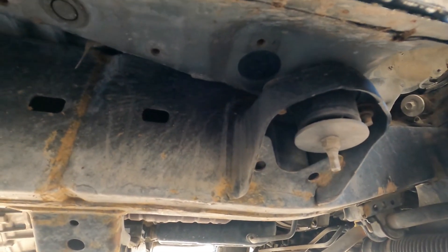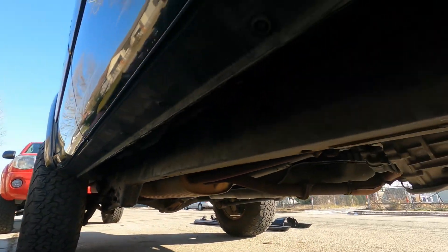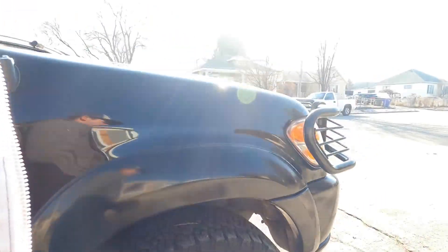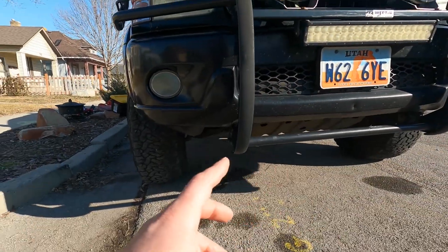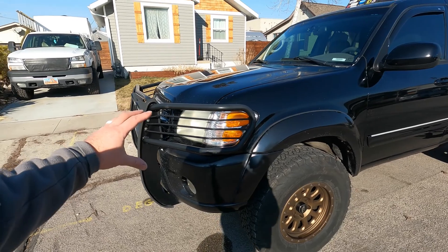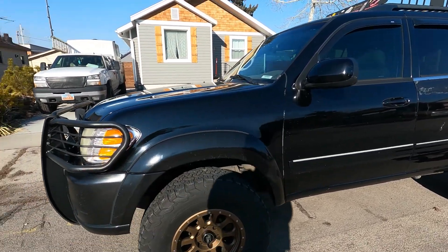So there's a mount there, a mount there, and a mount in the back — I think there's about eight mounts total. What I'm wanting to do is a three inch body lift. The other thing that's a little more work is that the bumpers attach to the frame, so we have to create some brackets to pull the bumpers up as well as the body. Make sure you subscribe to the channel so you can get updates as soon as I do those, covering how to build that kit and what all is involved. Let's get to it — get these rock rails put on.